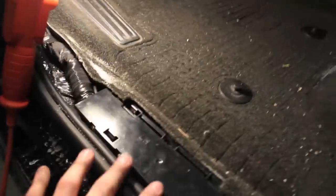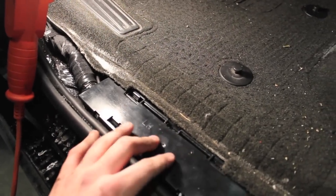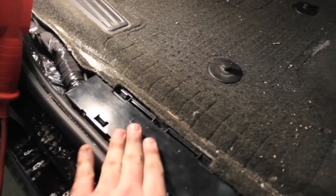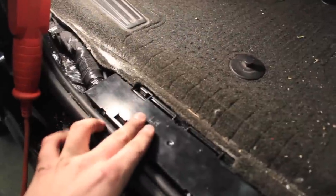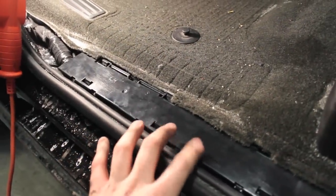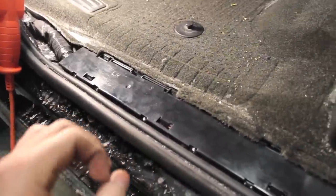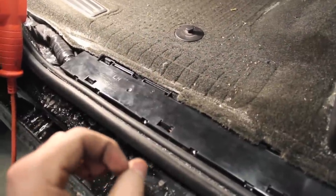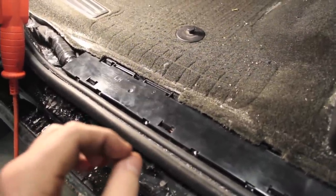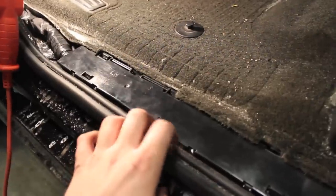That black cable is running here with the two connections right here. Try to stagger your connections so you don't have a big mass all in one spot — I did that and I have a lump right here under the carpet. Connect one of the green and blue wires here and the other one maybe a bit further back. You're looking for a thick brown with yellow stripe and a gray with green stripe in the stock wiring harness — they are notably bigger than the rest of the wires. Look at the link in the description to a forum post on GMTrucks.com if you're having trouble identifying those colors.